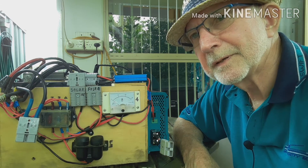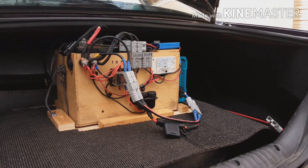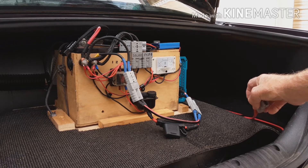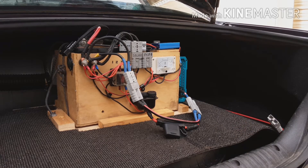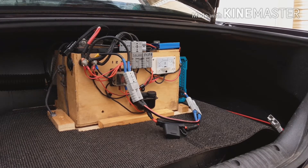I haven't tried it yet but I'll put it in the boot of the car and start her up and see how she goes and let you know. Now the battery is set up in its home at the boot of the car. What I need to do is connect it to the circuit I put in, plug it into the back of the DC-DC charger and start the car up. Hopefully it will start charging — mind you the battery is fully charged so it won't be putting too many amps in.